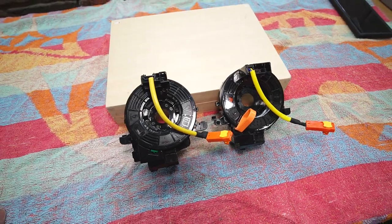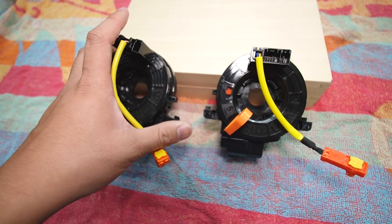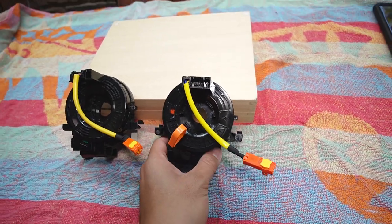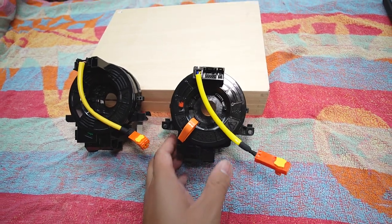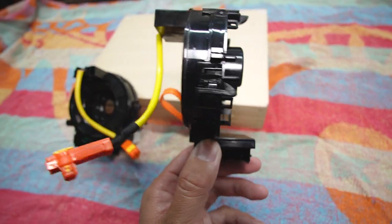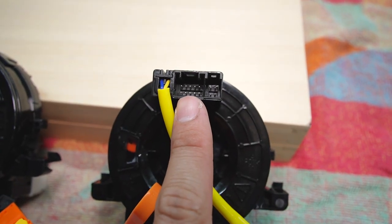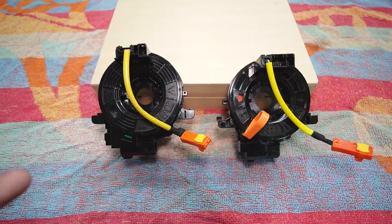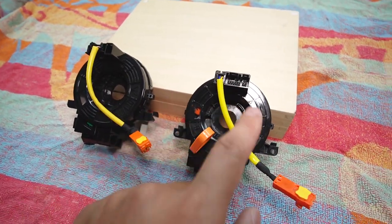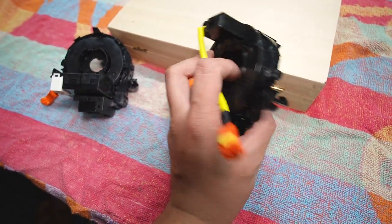We are going to be upgrading the clock spring. Now, there's a certain business telling people that this is an illegal upgrade, but that same business also has a 79 series with 40-inch tires — so I'll let you think about that one. This is the factory 79 series clock spring, and this is the N70 clock spring — from a 2012–15 model with VSC, sourced off eBay for $19.99. I've had this in the car for almost two months without any issue. It's just a piece of plastic with a bunch of wires inside. The reason we're upgrading to this is because it has a 10-pin connector housing, and that's the only way we can properly wire in our steering wheel controls. The dimensions are absolutely identical, the tab mounting locations are the same — it bolts right in. The only difference is this one has additional wires for steering wheel controls. All we have to do is change over this little sensor box here — it just comes off and bolts straight into the new clock spring.